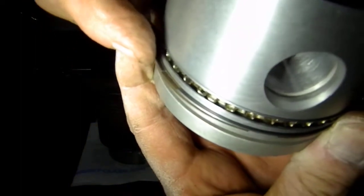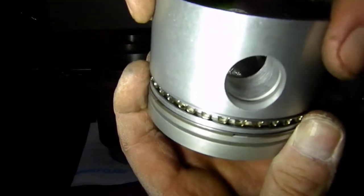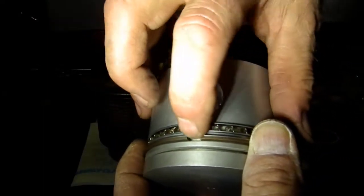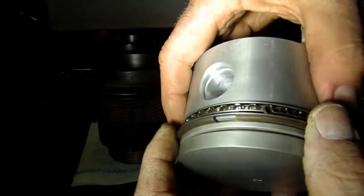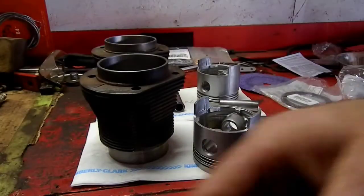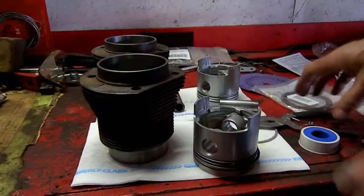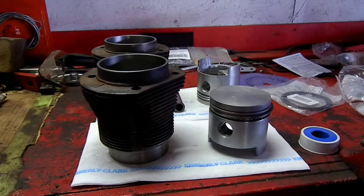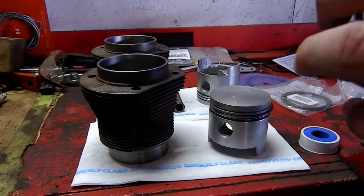When that's all compressed it closes that gap up, and then closes the gap up on the main ring itself, which gives you that tighter tolerance to be able to run boosted engines, nitrous engines, different types of ways of increasing power. Of course you have to have the rings to correspond with that.